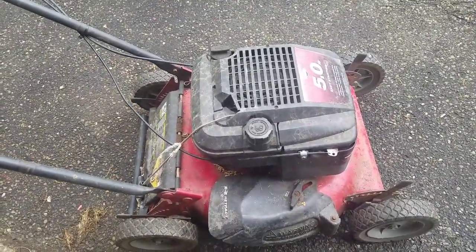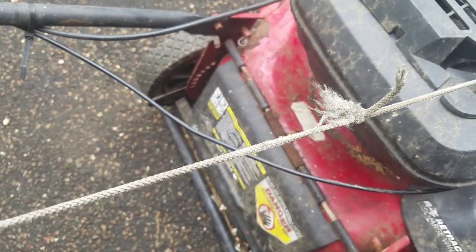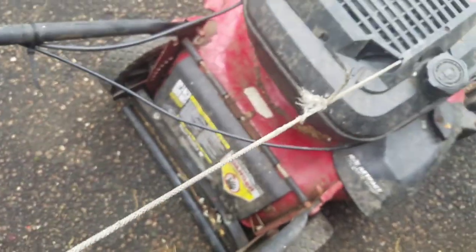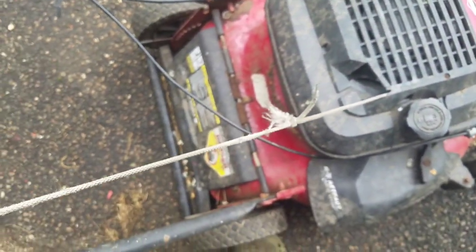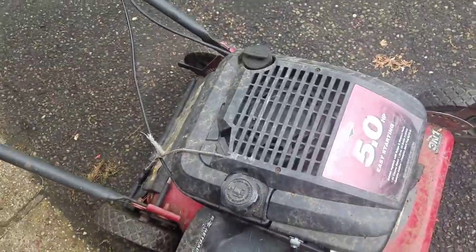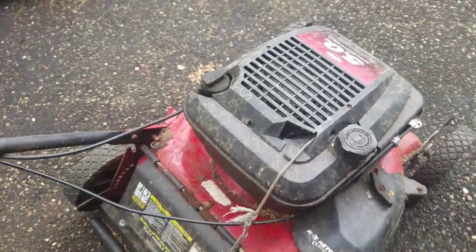I never know where I'm going to get these things — I just look at an address and go. The foot protector was off; I put a screw in there and a screw there, so now it's good. Has a little rust but the frame is still intact. I think I might even have a bagger for this. The pull cord is jerry-rigged — broke and tied up — but the stopper is there so it actually pulls. It just doesn't reach properly so I'll re-rope it, then check if it starts. There's no gas in it and it probably needs a carb clean.